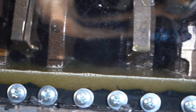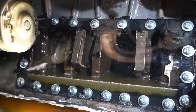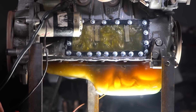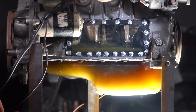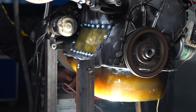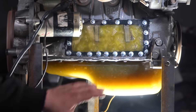Check this out, guys — things have gotten interesting. You can see that the oil goes all the way up to this little window. The oil level is just crazy; there is way too much in there for the good of this engine. Let's give the engine a turn without starting it and see what happens. The oil level is just way too high — the engine block immediately gets filled and you can't see a thing. It started like a charm, but now you get the impression the entire engine block is filled with oil.